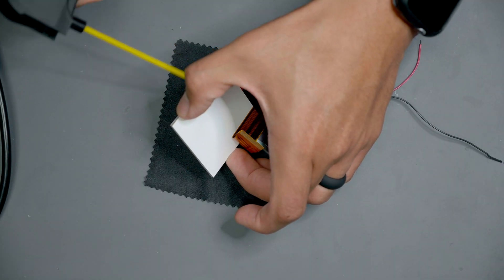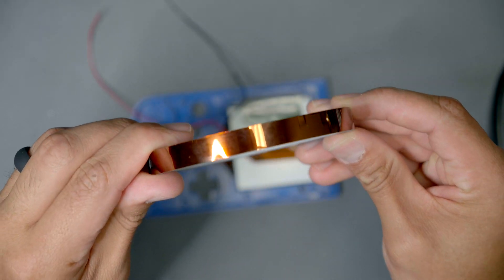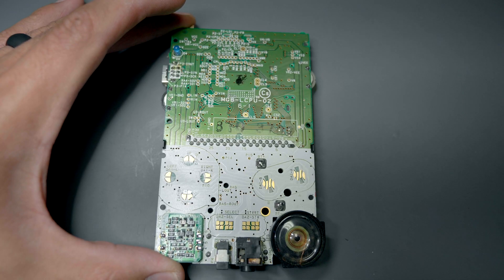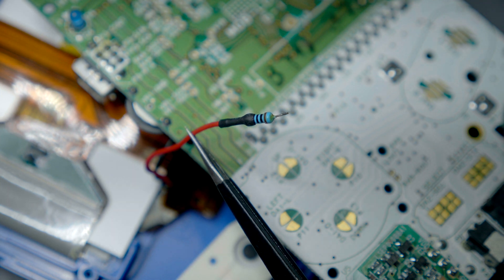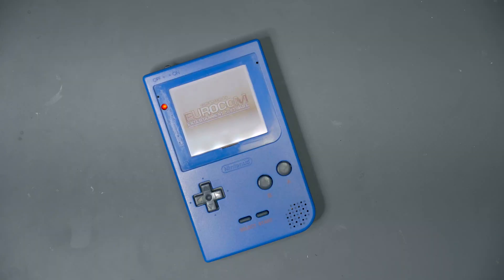It's always handy to have a little canned air to work out any excess dust. Once you have the layer centered, install the LCD panel back into the shell and check to make sure it's still centered. From here we can use Kapton tape to hold our assembly in place and finish up our mod by soldering power to our LED panel. Ground is connected to the far left pin of the cartridge slot component, and power is pulled from the far right pin. Before we solder in power, we want to attach the included resistor to the end of the wire and solder it into place. The resistor helps by lowering the voltage going to the LED panel — without it, the LED panel can be brighter but it can also cause flickering or burn out the panel quicker. Now that the LED panel is soldered into place, all that's left to do is reassemble and test.